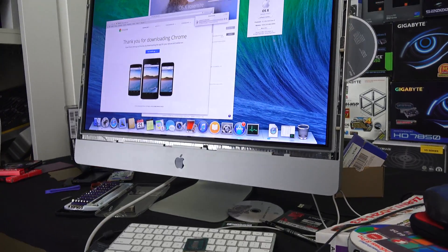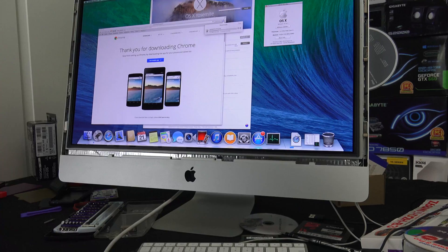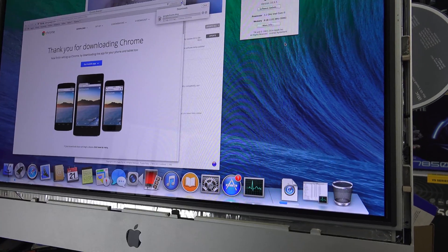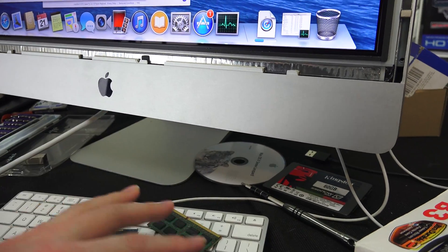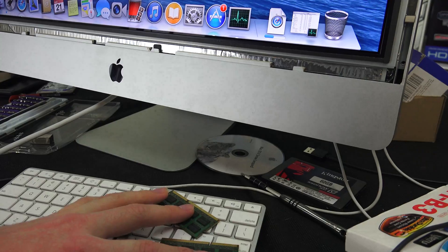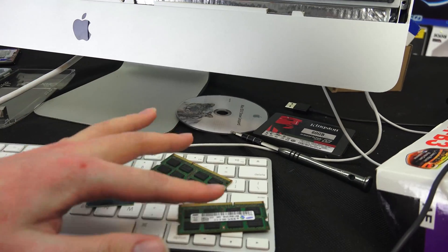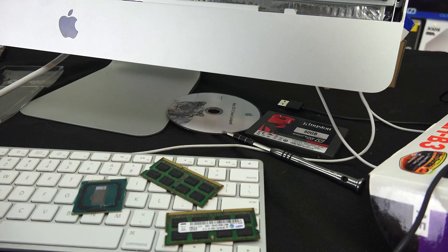Two days have passed since the last thing we actually did with this system, and as you can see it's working. All my great computer skills of pulling this thing apart, finding things, pulling the CPU out — it turned out to be completely and utterly none of what I needed to do. It turned out that one of these two RAM DIMMs just wasn't being compatible with the upgraded set that was already in the device.